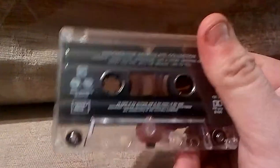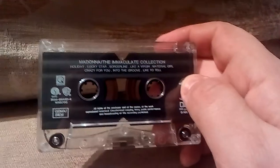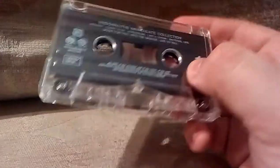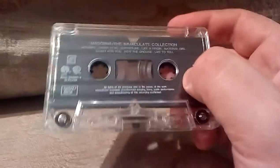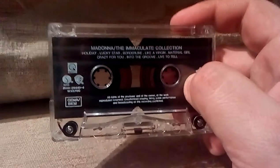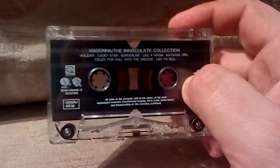I bought it not rewound, so apologies for that. This was the technology of the time, ladies and gentlemen. You can tell different colored tapes — that one's like a brownish tape, which means that's ferric or ferric oxide. There were some different tape types: ferric, chrome, ferro-chromium which didn't really take off, and also metal as well, which requires a higher bias frequency to record on. But this is a cassette tape.